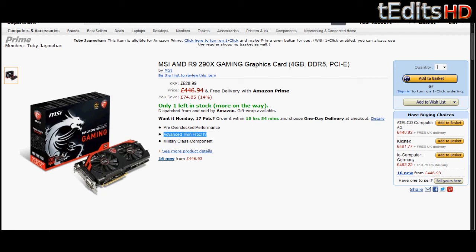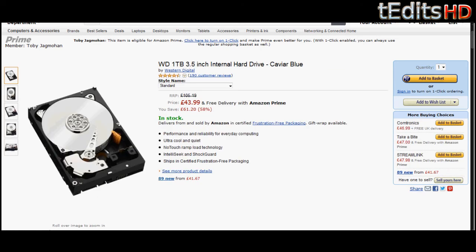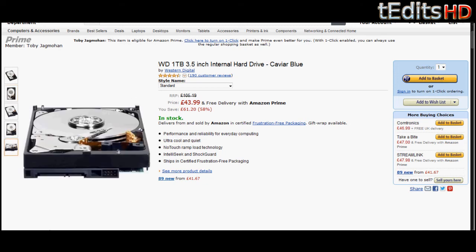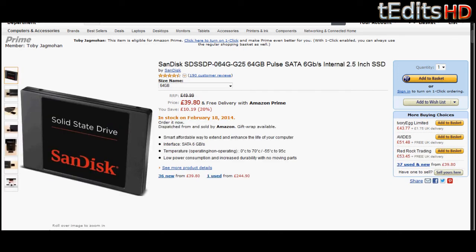Coming onto the hard drive, we're going to be using a 1TB Western Digital Caviar Blue. This will be more than enough for your games, videos, music, and whatever else you want. If you need more storage, you can get a 2TB version, or a 500GB version if you need less. The price range is usually about £30 to £50 depending on the size. If you already have a hard drive from a previous build, you can get an SSD instead. We have one from SanDisk at 64GB, which is in the same price range as the 1TB hard drive. The main benefit of an SSD is that you can put your operating system on it and it will start up and close really quickly. Games installed on an SSD will also start up incredibly quickly — they won't give you an FPS boost, but load times will be much faster.